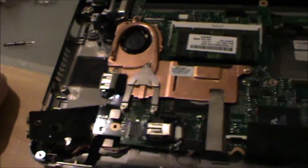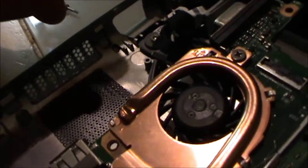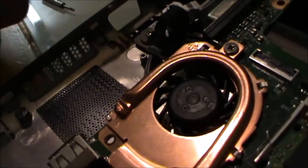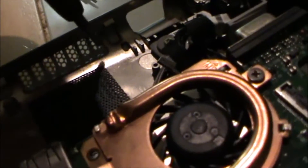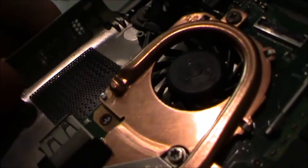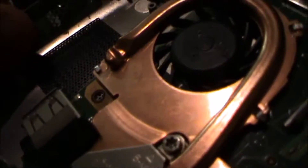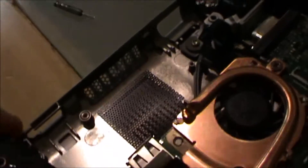The motherboard has been taken out and pushed aside. This meshing is between the two layers. The bottom part of the chassis is a plastic construction surrounded by aluminium, and the mesh is sandwiched between them. You're going to want to get yourself a screwdriver or some other blunt instrument and push it through. It probably will tear and end up being a mess, but you're going to be saving your machine from certain death.